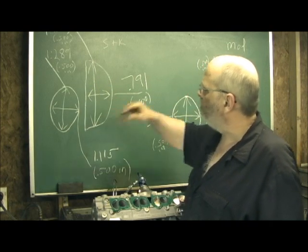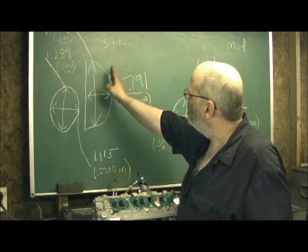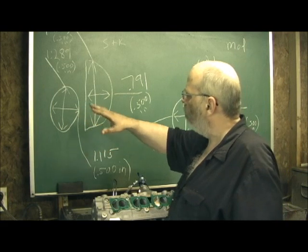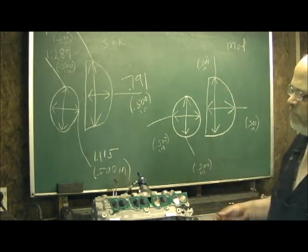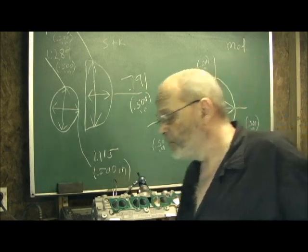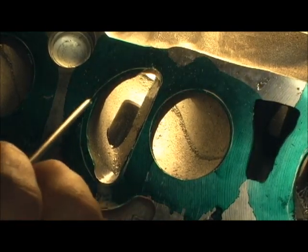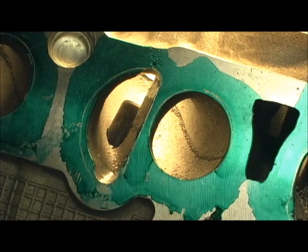The main area we're going to look at is this D shape — this is our baby right here. This is the problem. The D is real little, and the gasket that we used gave us a considerable amount of material to change right here and in the center. What that's going to do is create more of a pressure drop on this side. The center port is going to be more for your higher lift flow or your interstate cruising speed. We're concentrating on the D. Let's get a close-up look at these ports from the top side so you can see what a devilishly clever job Ford did — this is a really cool head for what they designed it for. Look how much more gasket room I've got. There's probably 130 to 150 thousandths right here that I can go in there and straighten that wall out so it doesn't have to make that turn so dramatic.